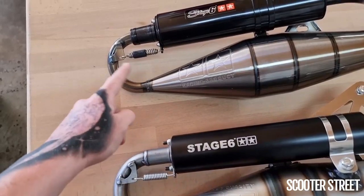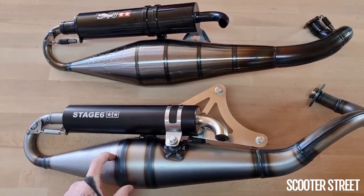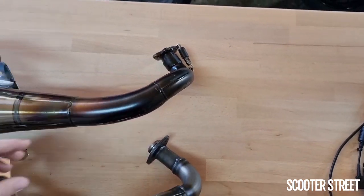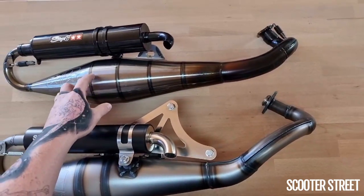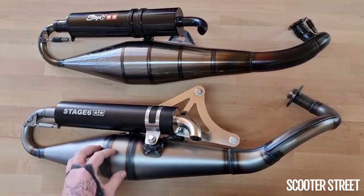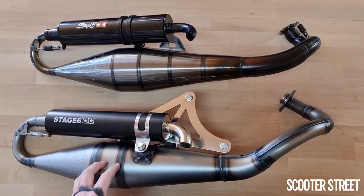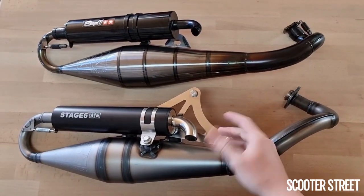The spring length and system between the rest is similar to many manufacturers. Now the chamber on the Mk1 is definitely bigger, as is the header — the header on the Mk1 is quite a bit larger and the expansion effect starts from the very top. I would say the Mk1 is a higher-revving exhaust — it's more of a mid-race exhaust — whereas the new Mk2 is more of a high-end street exhaust. You can still bolt it to a Bridgeport cylinder and it'll run really well, but you'll get a performance advantage from a bigger exhaust on a Bridgeport. To make a more fair comparison, the Mk1 would be more similar to a Yasuni C16.